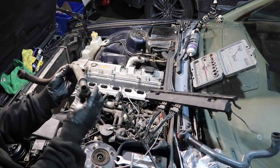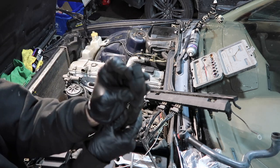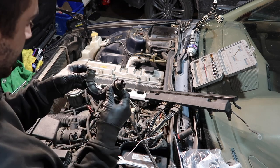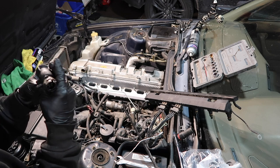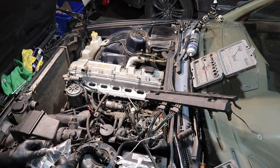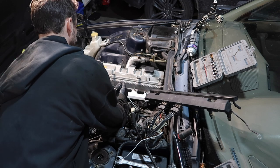This is the old one, and you can see here around the plastic connector for the intake boot, we are completely split. So that's a nice vacuum leak there. This one I don't even think was cracked, but just a precaution. This one's cheap, so kind of dumb to not replace it. This one itself is actually good. I'll probably keep it as a spare. But this had the plastic connector broken off, as they always do. Perfect. Old one. Get this back on the ICV.